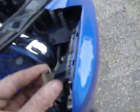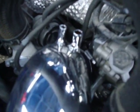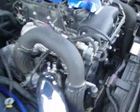This is an opportunity. Let's go check this out. You see this little rubber bumper pad that came with it. Notice that there isn't a whole lot of clearance here. The point of this rubber bumper pad is to sit right in there to protect your intake from getting all scuffed up. So let's go ahead, install the little rubber bumper pad, make sure everything is lined up, that your clamps are where you can adjust them, and once we get that done, we'll look at installing the filter.